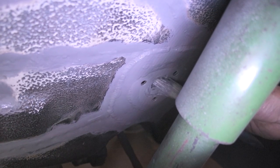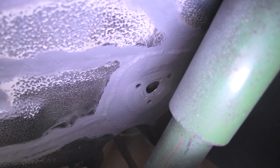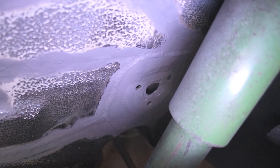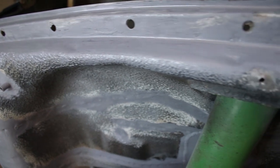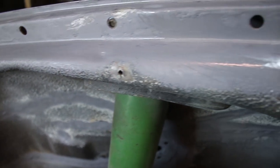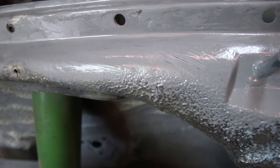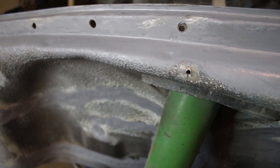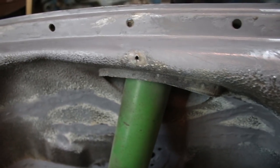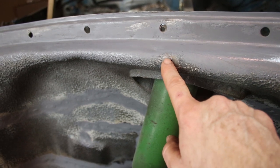I'm just washing epoxy primer into those crevices so it can wick its way in between that hollow metal. This is a very light coat here on the rail of epoxy primer — you can see the brush marks and it's real thin. I just tried to do the first coat real thin. There's a hole here which is for some washer clamps; I think I'm going to weld that closed so I left that open.